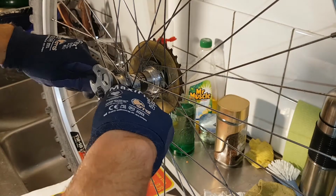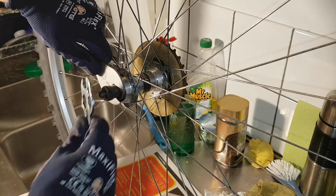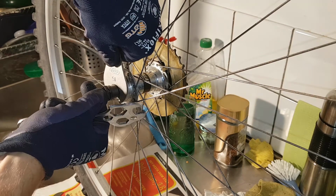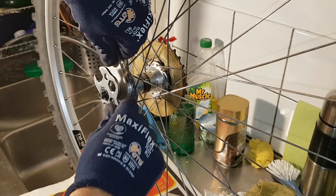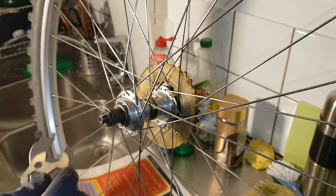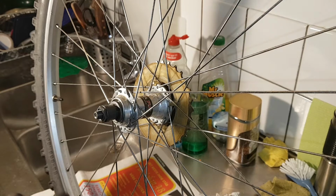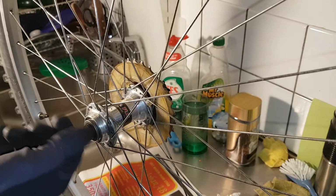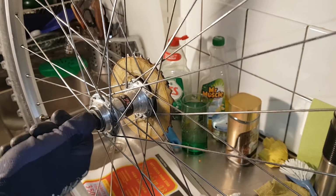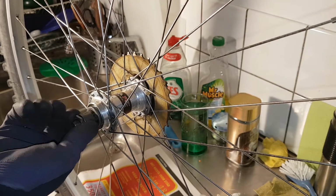I have to loosen it again. And tighten a bit on the inner one, keeping this one from turning, and then try it again. Yeah, I got some slack. Yeah, I continue doing this until I get it perfect. It can take some time. And now I'm pleased. Runs really nice. Took me some time, but just no knock and runs really great.